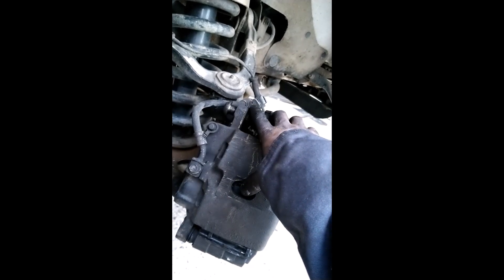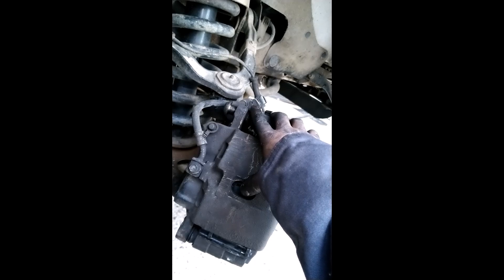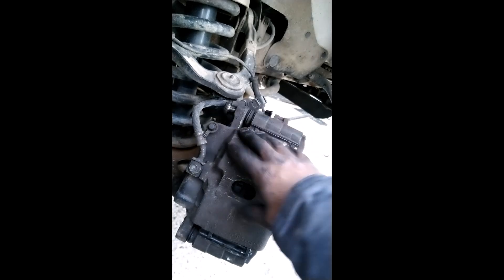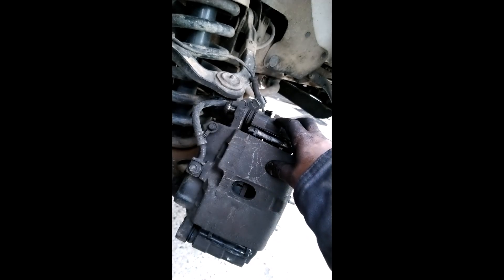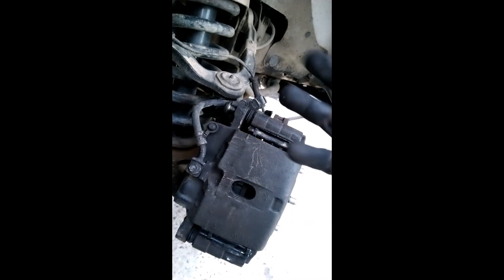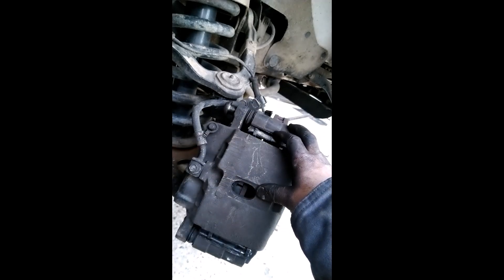After reassembly, drive your car for about 5 to 10 minutes stepping on the brakes — compress the brakes, step on them until they get hard. Once they get hard, drive for about 10 minutes stepping on your brakes slowly so the car can get used to the new brake pads. The caliper has to open back up because we compressed the pistons with the C-clamp. Put some pressure on your brakes for about 5 minutes until they get a little hard, then drive for about 10 minutes pumping your brakes and your brakes will come back to normal. That's how you change the brake pads.